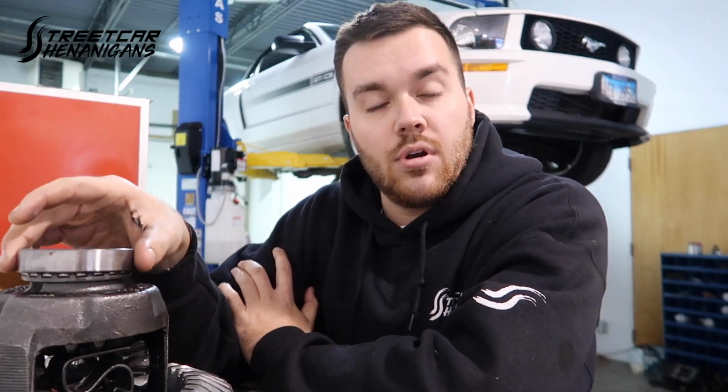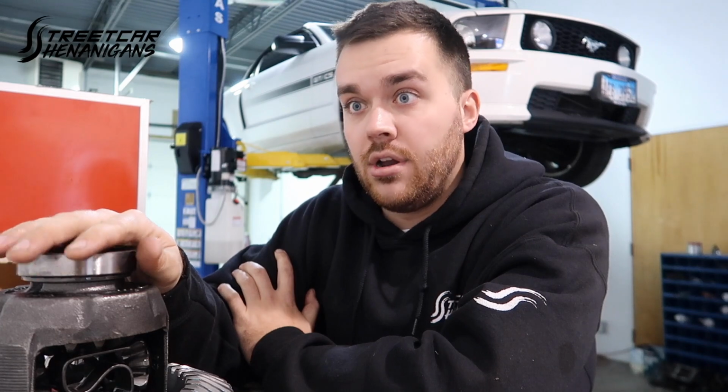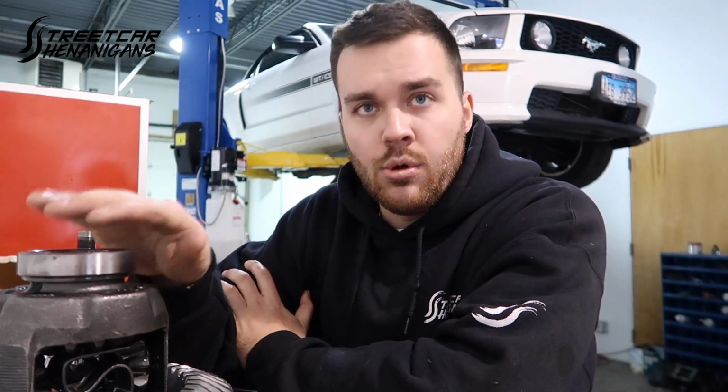And then the next guy said run a little bit more backlash. I had it set at 10 thousandths, but he said that a lot of success has been created over the years of putting 8.8s together on the higher side. 12, even as high as 15. He said he ran his personal car at 16 and it got rid of a lot of noise. So we'll probably put this in the 12 to 13 range when we put it in this time.